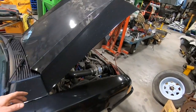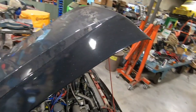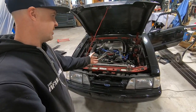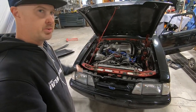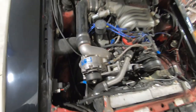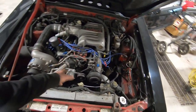Carbon fiber hood — they've painted this section and left the carbon fiber exposed there. Here's a look under the hood. You can see the car used to be red, that's fully exposed. I'm going to go out on a limb and say probably a built 306 with the Vortech. What do we got here? A V2 blower, a bunch of MSD stuff — the distributor, the coil, the 6AL2 electronics.